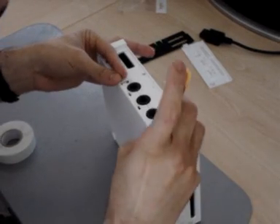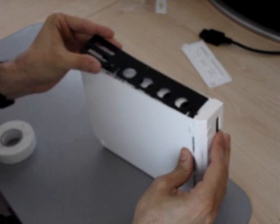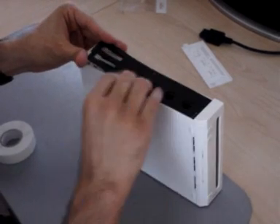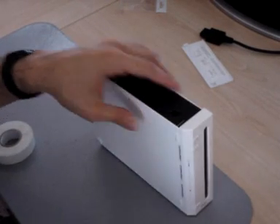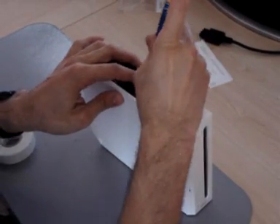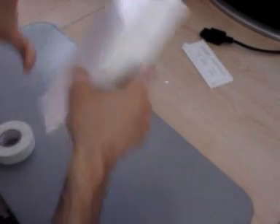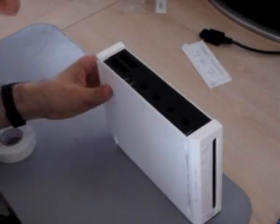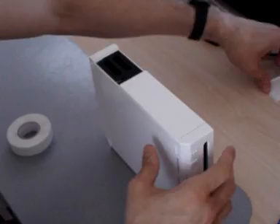Lastly we've got the two tri-wings. To put this back in, slide it in like that a tiny bit — you've got five little spots here so it clicks into place nicely. Once that's nice and flat, there'll be three black screws left. Put the longest one first — it goes on the corner closest to the face of the Wii. Then put the second one, and then the last one. There's one little sticker left, put that on, then this little bit here and this last piece — that's pretty much all done.